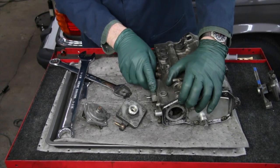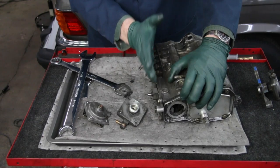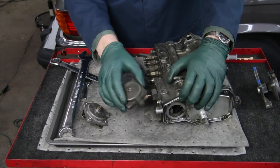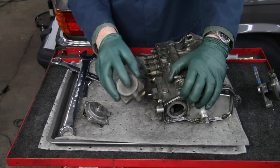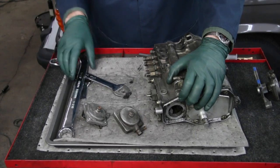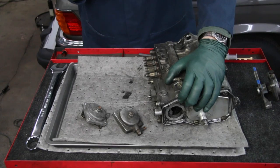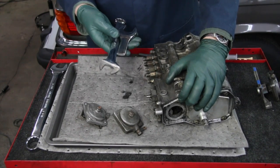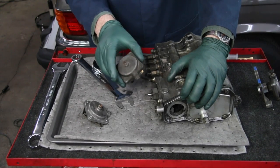Now you can see the big nut, and this pin does not come off unless you remove the plate, but generally the problem is not down in here. It's right here with this part. So if you find you need to install a replacement because of some problem you're experiencing trying to adjust the ALDA, keep in mind that the wrenches that we sell on my website that are used to remove and replace the oil cooler hoses on the OM617 engines will work to remove the ALDA on your injection pump.